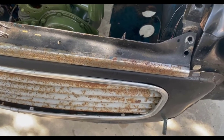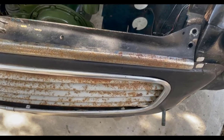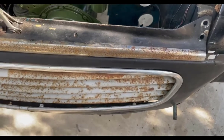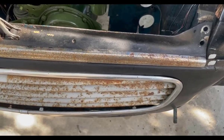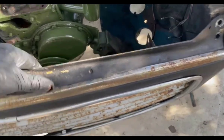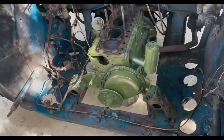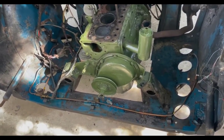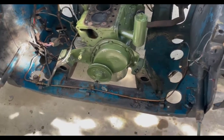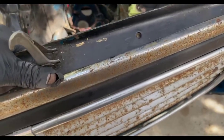We're at the final stages of removing this front section of the Morris Minor along with the grill. All the fasteners are out — and I have to say it was a real dog's breakfast of different types of fasteners on the bottom; I used just about every spanner in my collection. Once those are all done and you're sure they're all out, this just easily pulls away off the two bumper mounts, and then you have tremendous access into the engine bay with this off.